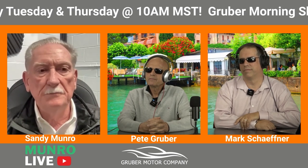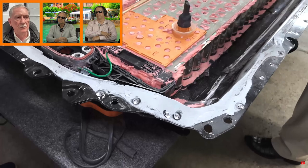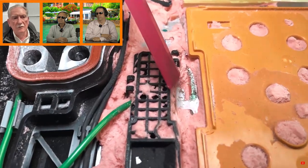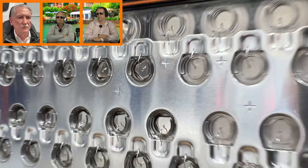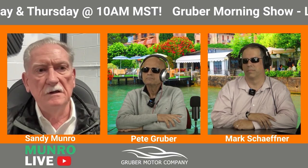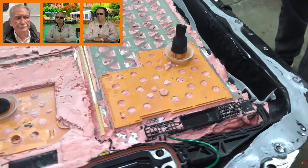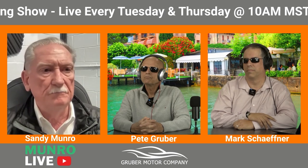Probably the battery pack won't need to be repaired. We have a thing about when we design products: do you want to make it serviceable or repairable? In a lot of cases, if I make it serviceable it's going to fail, but if I make it reliable then it won't fail. I know that in a lot of cases the connectors to the individual cells were falling apart on the original Roadster and the original S. But with this technique — putting the potting over everything, just sealing it up completely — my guess is that the things that are going to fail are probably going to be the battery control module, which is accessible, and maybe some of the connectors that go to or from the battery. If they've tested it, I think it's going to be really robust.